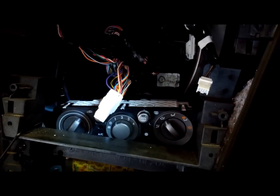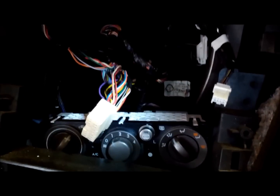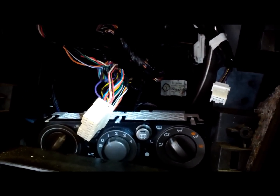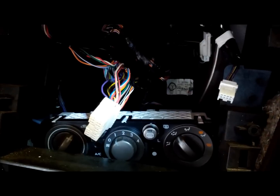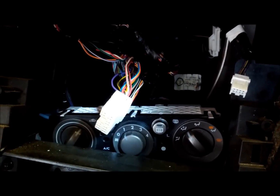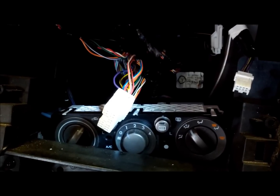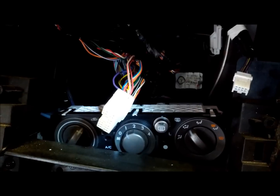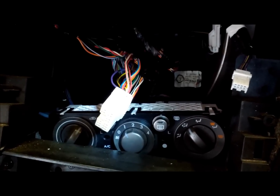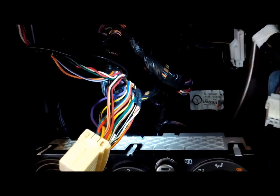I removed the white and black clip and the ground, and swung the radio onto the driver's floorboard. I've also removed the tape around the harness so we can separate them out to figure out which leads we need. I'll post a diagram at the bottom. You're going to need the left rear, which is white and red for the positive side, and red and black for the negative. The right rear positive is blue and yellow, and the negative is red and white. They're already taped together from Subaru, so they're easy to find once you know the two colors.